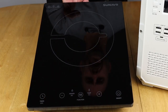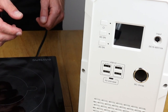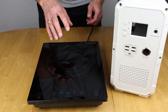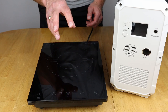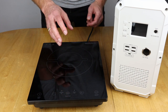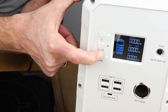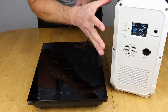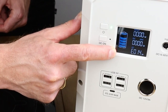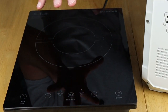So this is the appropriately named Sun Evo induction hob, rated at 2,000 watts — way over the EB150's inverter limit of 1,000 watts. While doing my research on Amazon I noticed these hobs were controllable, so I assumed I could turn it down enough to bring it inside the inverter's limits. I had no idea it was going to work, and initially when I switched it on I got error E014, which is actually short circuit protection, so I thought something was actually wrong with the induction hob.